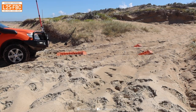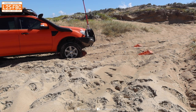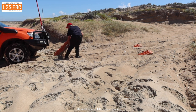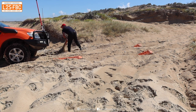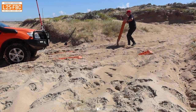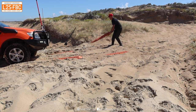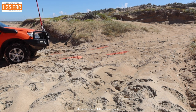I reverse back and stop — reversing back gives me a little chance to move forward again. Now I reposition the ramps, but this time I'm placing them in front of the wheels, not jammed underneath the tyre. The reason is the vehicle can actually move forwards two or three meters on its own, so I don't need the ramps to get it moving — I need the ramps to maintain momentum. I carefully line up the ramps, then stand on them to push them in. The vehicle gets moving on its own and then runs over the ramps.